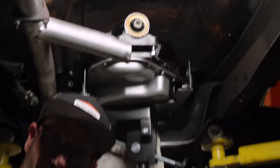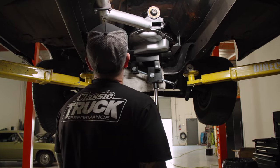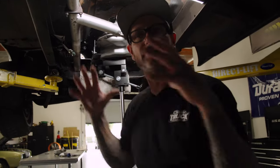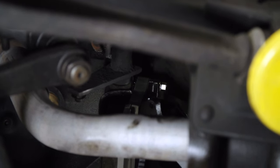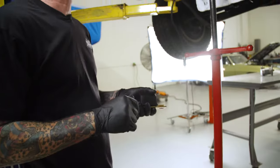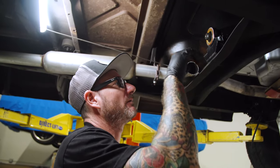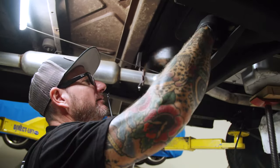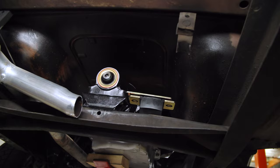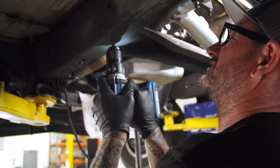The transmission is up against the plate - I was really nervous about that stud sticking out, but had no issues. Looks like we've got plenty of room in the tunnel area, and that's a big reason why we chose this transmission - because of the size. I thought about it and found another option. Instead of cutting up this trans crossmember, I went back to CPP and they had a different mount that's about three-quarters of an inch shorter, which now allows us to bolt it in. I'll drill a couple holes here - had to slide this back from stock location - and we'll be good to go.